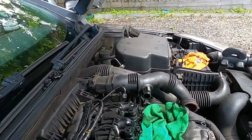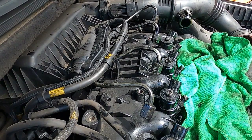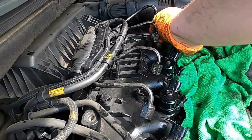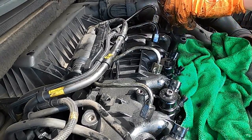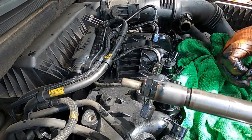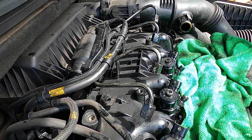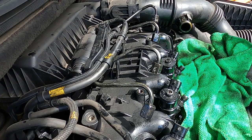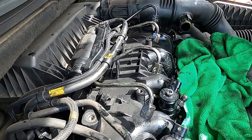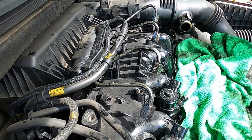Now this is the pure-luck thing — you're gonna have to remove these injectors. Now that you've taken off your rocker cover, you have a bit more space to move with. Oh — this one came out! Beautiful, and it also came out with the injector seal on it — so that's a win. That's one win for me. Second one — I just hope they all come out with injector seals. Yeah, it came out with the injector seal — beautiful, that's what you want.